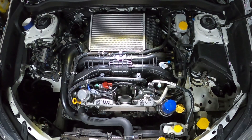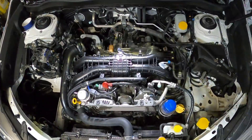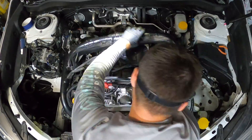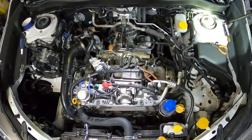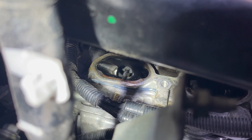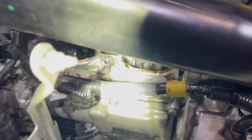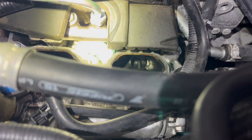I'm not going to get into how I removed everything — for that I'm going to shout out Jota Jota STI. They did an excellent job explaining how to get to these intake manifolds to clean them, step-by-step. I followed every step of theirs, so I'll link them down below. Once you finally get everything removed, you'll see which side is already open. As you can see in there, it is disgusting. These are direct injected engines — any direct injected engine needs this done every so often. This vehicle has 71,000 miles on it and I'm not sure if it's ever been done.